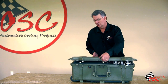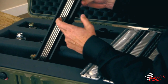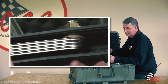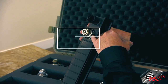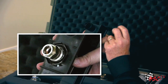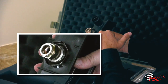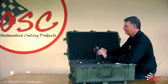We're going to talk about the oil coolers right out of the gate. First, let's show you the OSC unit. It has a four plate stainless steel cooler in there — that's what came on the original unit, so that's what we're going to put back in it, meeting or exceeding the needs of the original equipment. You're also going to notice that we use the GM style original power nut. It's a tension spring that allows it to seat and keep pressure on that gasket through different temperature levels, hot to cold. We've also torqued it in position and marked it — an old-fashioned thought from the 60s and 70s — to let the technician know the job's been done properly.